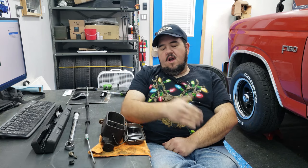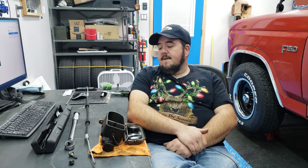And subsequent times I tried it, it began to get worse and worse at holding the truck, to the point where it wouldn't hold the truck hardly at all. So I chalked that up to the cable stretching and figured I'd come back to the garage here to do some adjustment, tighten things up and, you know, take it out again and give it another try.